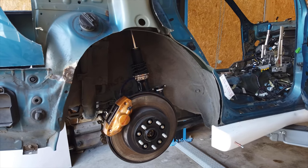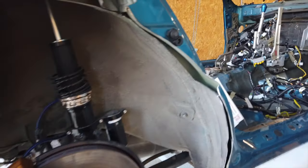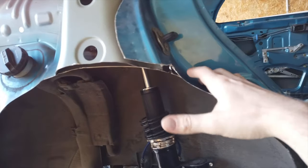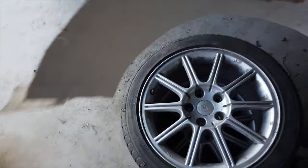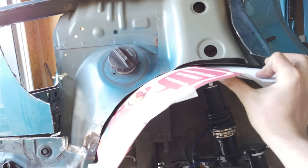I've just finished making the major cuts and the wheel now has as much clearance as it's going to get. I went all the way to the inside of the wheel arch here, which is what people do with WRC kits, but in my case I had to cut into the door jamb which is going to transfer over to the door, but that's for later. For now what I'm doing is focusing on rebuilding this wheel arch, so I took this cardboard and I'm kind of placing it in place of the wheel arch and figuring out how much metal I need.